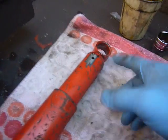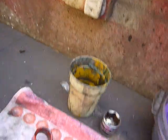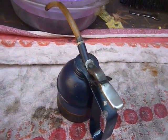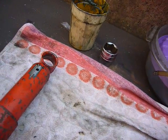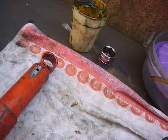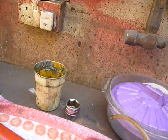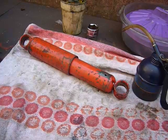Recap: clean a bit of surface so the weld will take. Drill a hole. Pump it into a cup and measure how much you've got. Use the grade you want — 10 grade, 20 grade, or 30 grade in the extreme. Put it in an oil can. Squirt it back in. Weld it up. You might find initially you think it's soft because you're compressing air, but if you turn it back up the right way, within about three strokes you will see you've got one tremendous shock absorber. We'll leave you to fiddle in your garage and see if you like the result. Catch you later. Bye.